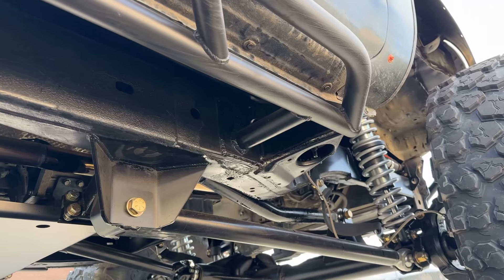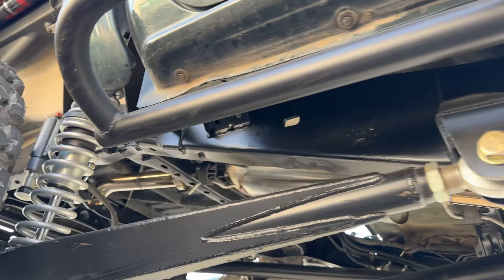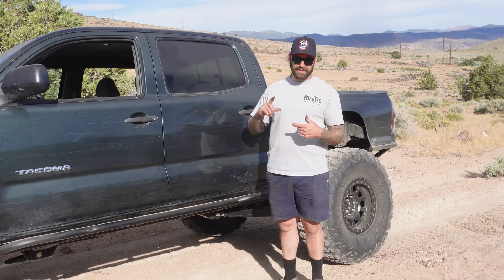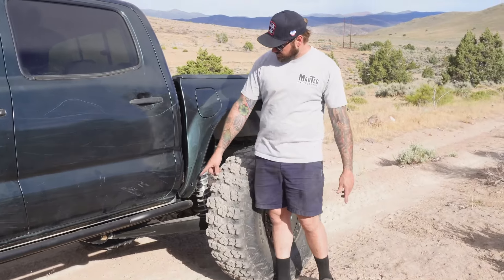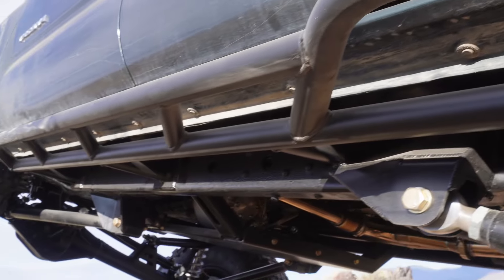Next on this thing are our sliders — the exact same slider that's on our red truck. They work so good there's really no point in changing them. These sliders weld directly to the frame. We have four outriggers on them — three straight ones that go from the frame out, the frame is plated where all the outriggers land, and the rear has a long one that goes all the way up to the back side of the chassis to stiffen everything up.